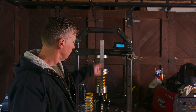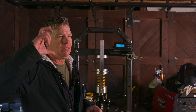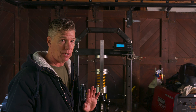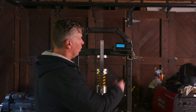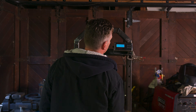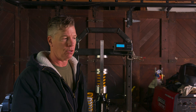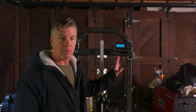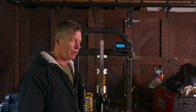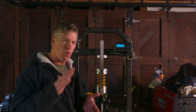I don't have a digital readout on this gauge, so I just have to look and line the lines up. It's not accurate to the thousandth of a millimeter, but it's very close. At 10 millimeters, it's about 300 pounds of force — or 138 kilograms. I grew up around pounds, so I know about how much 300 pounds is — it's more than I can lift. Just carrying that shock around before it even goes in the bike, it's got that much force already on it.